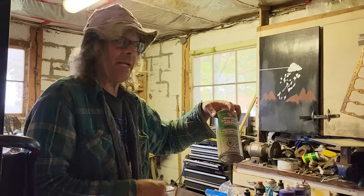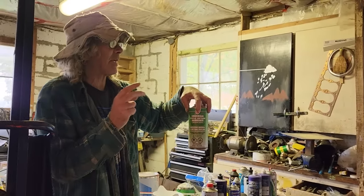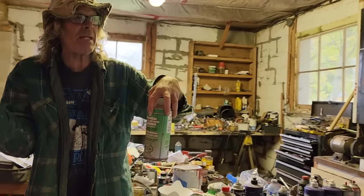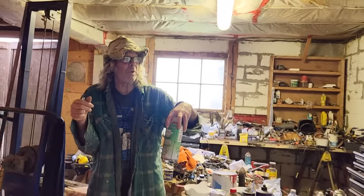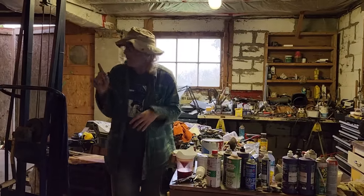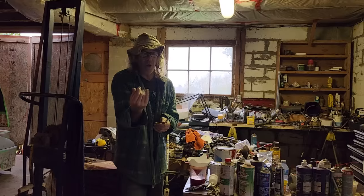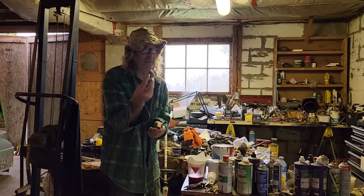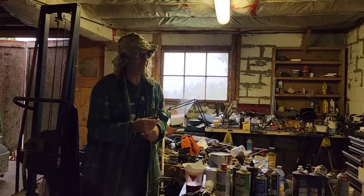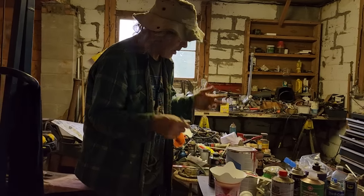Right. And the epoxy, in the cold and hot, is still drying, and the chemicals coming out of the epoxy into my urethane red paint are softening it up to the point where, when I used a putty knife on the front fenders, oh, and red? I balled up epoxy and red paint into a little ball, wet, and threw it out the window. That's how soft the paint was. Oh, wow. In the sun. Like, no, use your hardener.